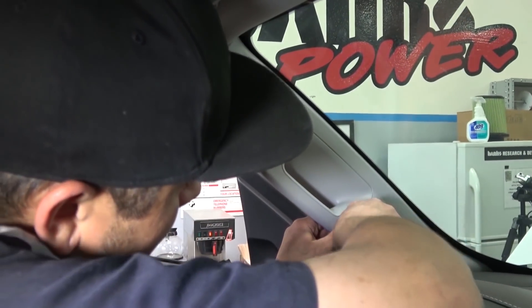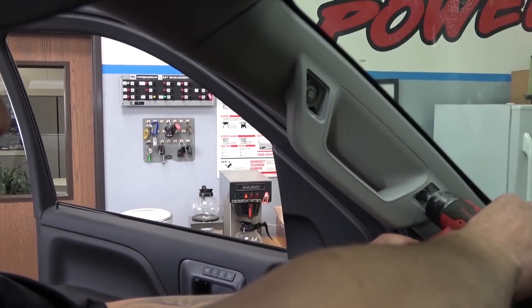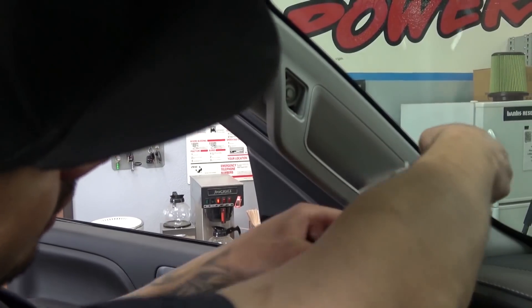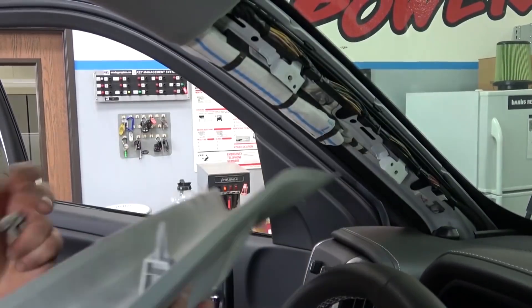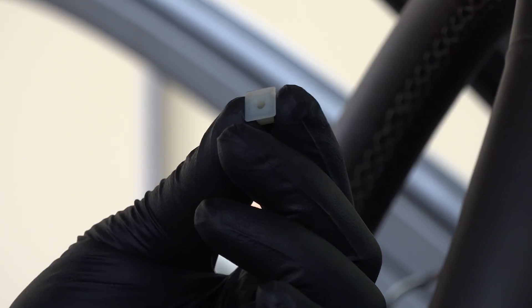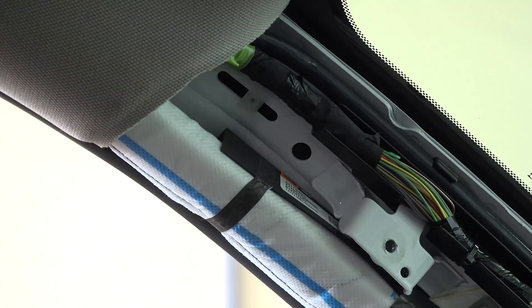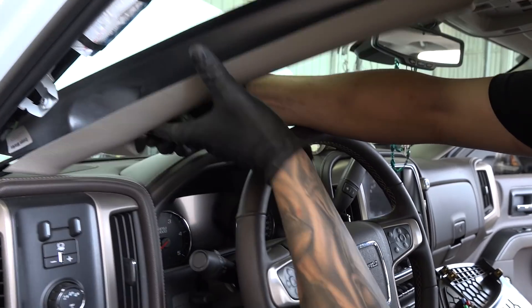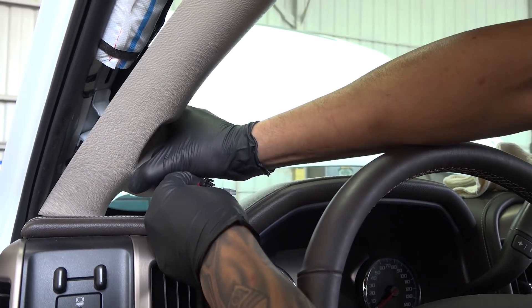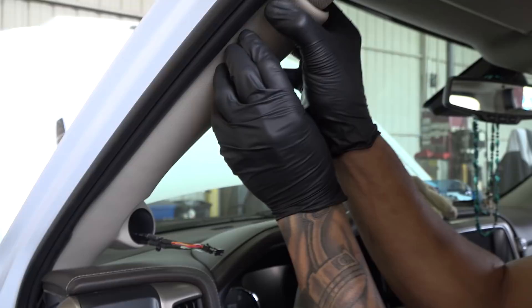If you've purchased the Derringer kit with i-Dash and a pillar mount, it's time to remove the stock pillar. Do so by removing the two plastic covers above the 10mm bolts — you can use a screwdriver or plastic pry tool. Be careful not to leave a permanent mark in the plastic pillar in case you want to put it back. Once you've removed the bolts, pull the pillar back towards the steering wheel and then up. Find the white nutsert — it's small and plastic, don't lose or break it. Locate the elongated slot at the top of the pillar and insert the plastic nut into the center of the slot. Slide the wires through the gauge hole leaving about 4 inches exposed, then push the pillar down into the dash and use your thumb to pull the weather stripping out and around the pillar to hold it in place as you prepare to put the screw in.